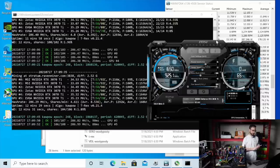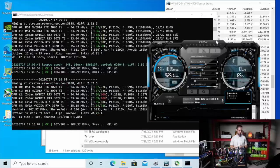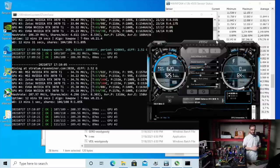We were at like 33, 34, 35 mega hash per GPU — 206 mega hash for the whole rig. We've already got the memory temps going up. We're up to 208 mega hash. I got a fan stalled here because of the cable — that might be why that card is running a little hot. This just might be a thing with these 3070Ti's — that GDDR6X memory just runs so, so hot.